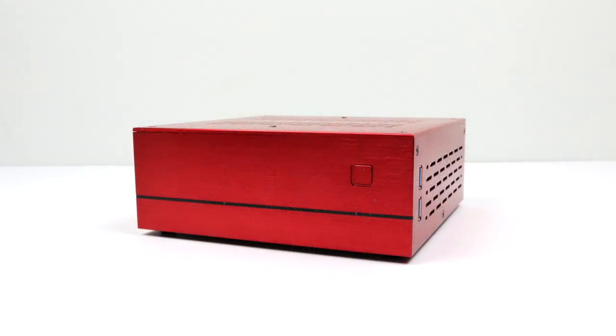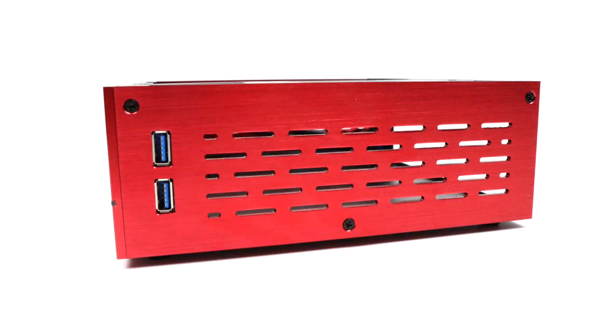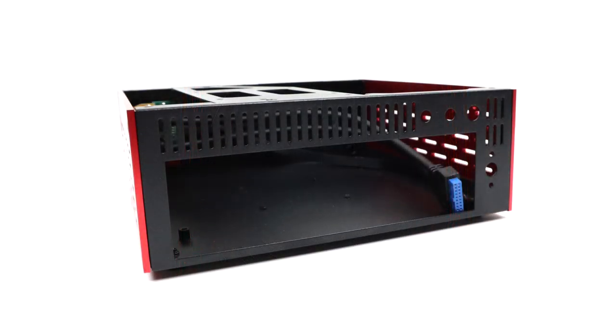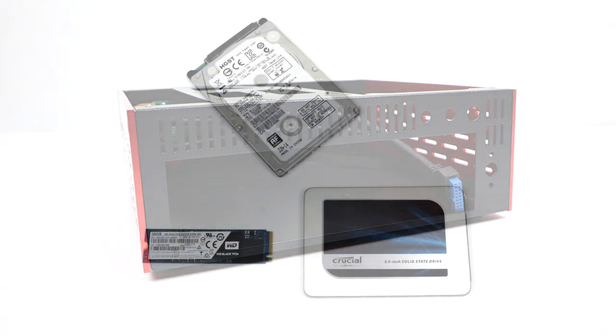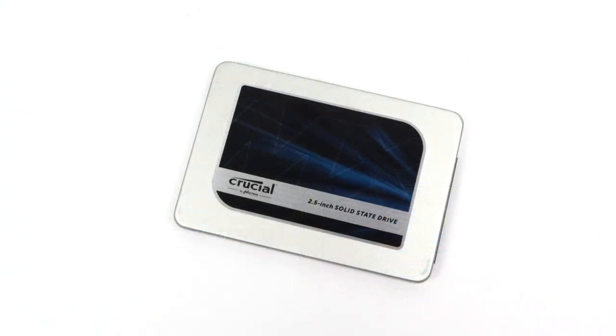Finally, the case — this is the A01 all-aluminum Mini-ITX case available on Amazon. You can get it in black, red, or silver. They also have a tempered glass version but unfortunately there's just not enough airflow for this APU, so I stuck with the vented aluminum top. It's a very basic case with two USB 3.0 ports on one side, a front power button, front LED, and a hard drive bracket. We're not going to use that bracket because it blocks airflow, so we'll place the hard drive on the side. Storage options include a mechanical drive, a 2.5-inch SSD, or an M.2. I already had a spare Crucial MX300 500GB 2.5-inch SSD so I went ahead and used that.